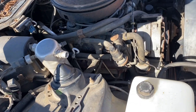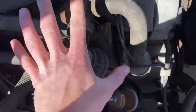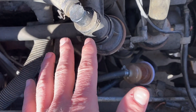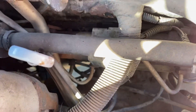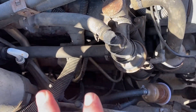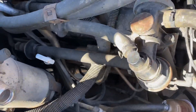This vehicle does not need to pass emissions and the emission stuff on this is broken anyway. So to save on some space I'm gonna go ahead and pull this whole system out because this doesn't even have a belt on it and the cat is not on this vehicle. Anything that's EGR-related I'm gonna be plugging up and making it as straight-through as possible for a better running condition. I'm gonna get the carburetor as not vacuum-leaky as possible. This is just held on by what looks like two 10mm bolts, so I'm gonna pull this whole unit off and figure out which of these things need to be plugged up.